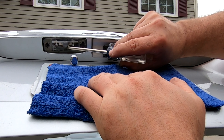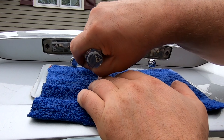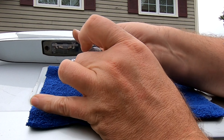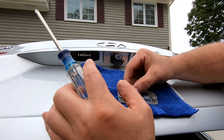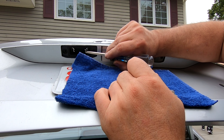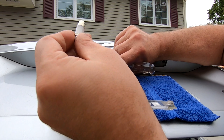You're going to see there's two lights for the license plate. It's a Phillips screwdriver and you pretty much just unscrew those screws out. Pop the cover off. If you push on the pin, the bulb should pop right out.